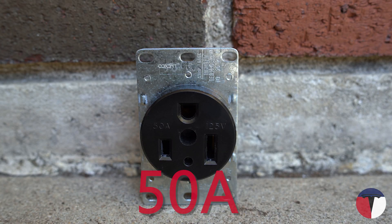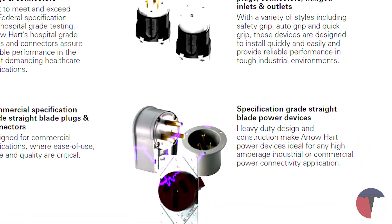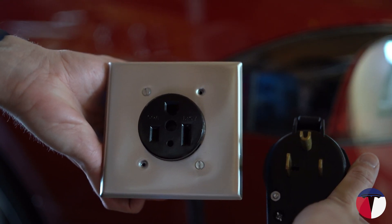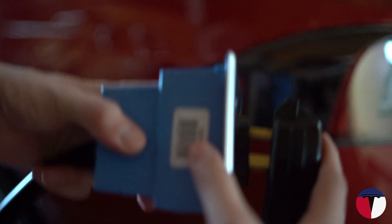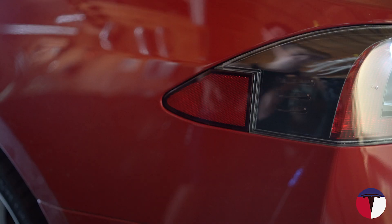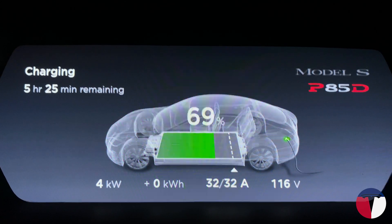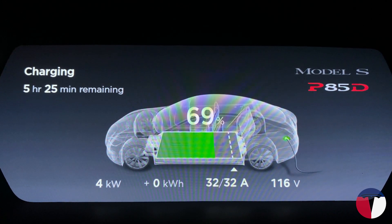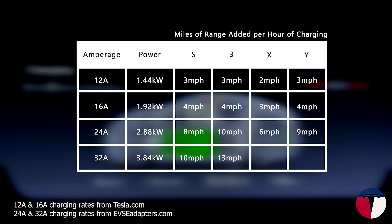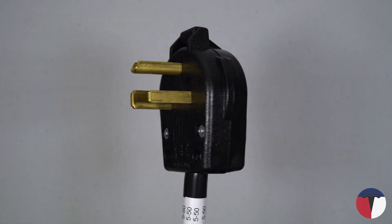The last group with a sole resident is the 50-amp group. The beefy NEMA 5-50 outlet is used for high-amperage industrial or commercial power connectivity applications, according to the manufacturer's website. These receptacles output a whopping 40 amps, which should outclass all others when it comes to power output — well, kind of. The Tesla Mobile Connector is limited to 32 amps of output, so instead of 4.8 kilowatts at 40 amps, you'll get 3.84 kilowatts. Even with the 32-amp limitation, this is the quickest way you can charge with a Tesla Mobile Connector at 120 volts, charging your Model S at around 10 mph, Model 3 at 13 mph, Model X at 8 mph, and Model Y at 12 mph. The adapter is listed on EVSE Adapters' website for $77.